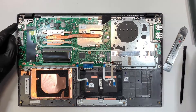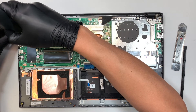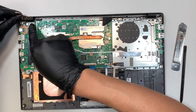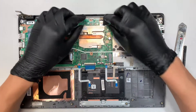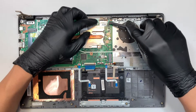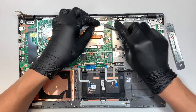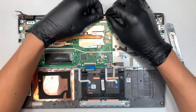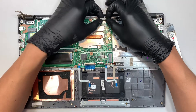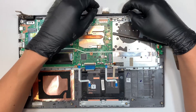Let's go ahead and remove the motherboard. We need to remove two screws and lift the hinge up, because the hinge is part of what holds down the motherboard. Now we can start disconnecting some of the wires. This one is the 30-pin connector for your LCD. We need to get this plastic out, and then slightly pull away from your body — there's no clipper or anything; this tape right here is holding down the connector. Slide it away from your body in that direction — that's how you disconnect the LCD cable.